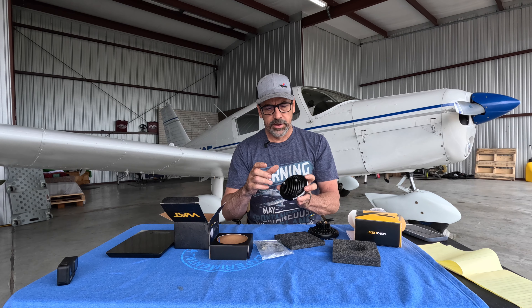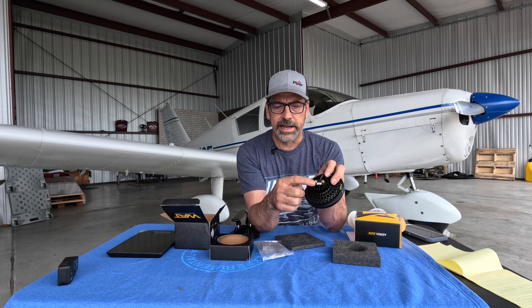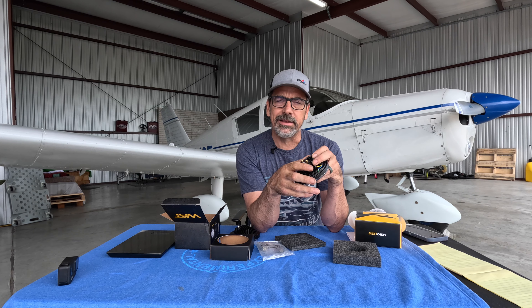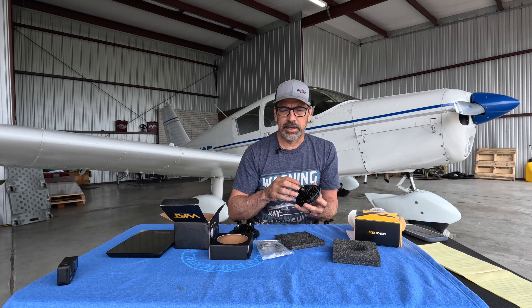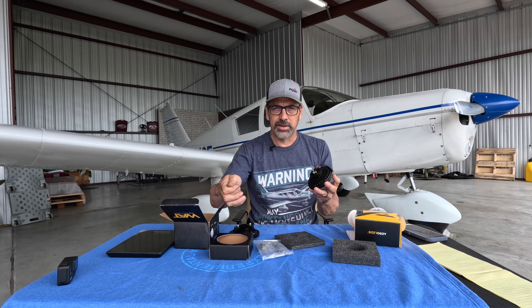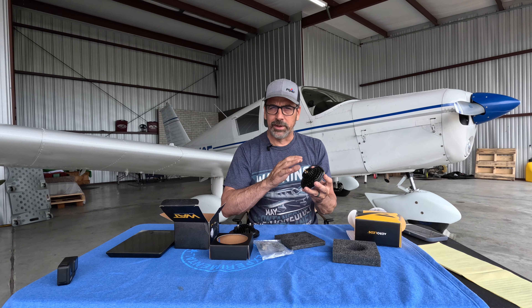On the backside you have your wire hookups — a minus and a positive. When those get hooked up you have to make sure you hook them up in the right orientation or it will not work. The AeroLED has the same thing — power and ground connectors — except with this light, being it's a landing and taxi light, you have to wire in a reverse polarity switch to get that to work. When it's in the landing position one wire is positive; flip to taxi and the polarity reverses. So you'll have to hook it up and play with which one is positive and which is negative.